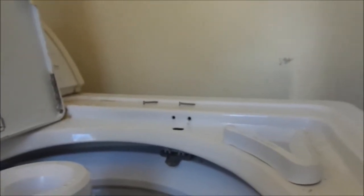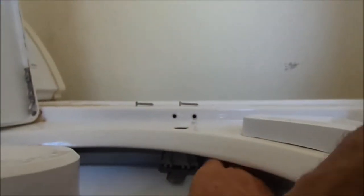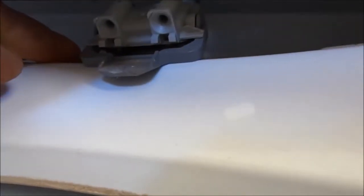I'm going to do a quick repair from the top here. Ideally you want to replace the switch, but what has happened is this switch is a clamshell design — it has two halves, and the bottom half has come loose.